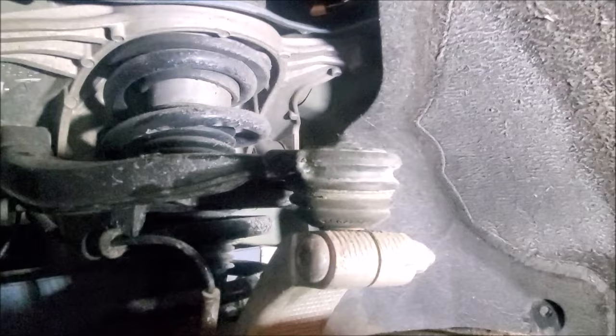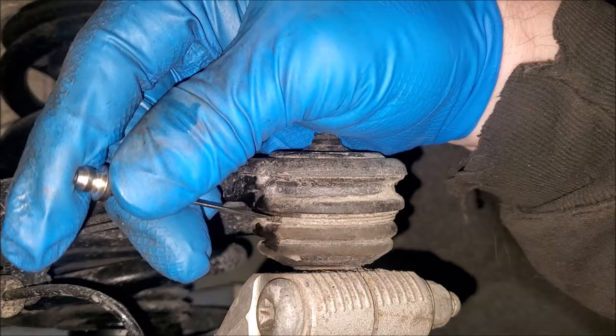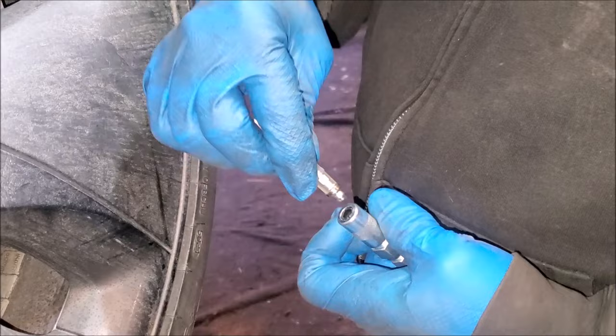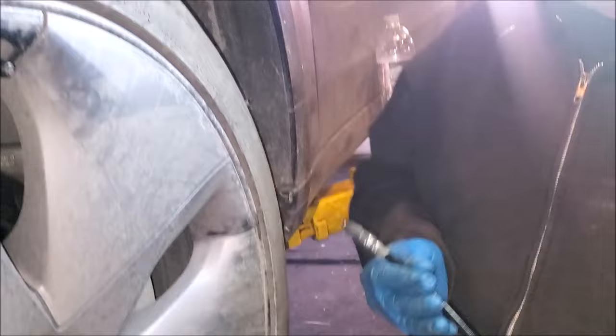Be careful — this is very sharp. We are going to go over to our Tesla. What we are going to do is make a hole on this side, and then make a vent hole on the other side. We are going to use the needle unattached and put a small vent hole in here so the grease can escape and let some air out. We are just going to poke a small little hole in there. Then we are going to attach this to the grease fitting, tighten this down, take the cap off, and be super careful handling that.